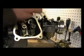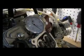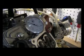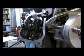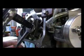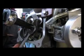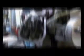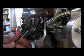Install the choke hold bracket. I used a dial indicator mounted on a bracket to find the precise point where the piston is at top dead center. Top dead center is where the piston is at the top of the cylinder and the valves are not moving — this is where you set the lash gap. You can also find this point by simply turning the engine over by hand. Using a feeler gauge, set the lash gap on the intake valve to 2 thousandths of an inch and 3 thousandths on the exhaust valve. You first need to torque the black locking nut to 7 foot-pounds on each side. You can use two wrenches to tighten or loosen the rocker arms by moving the bolts simultaneously.